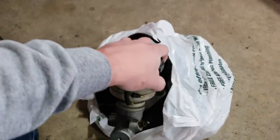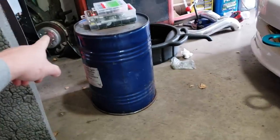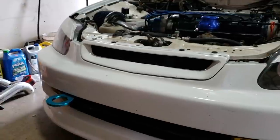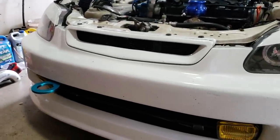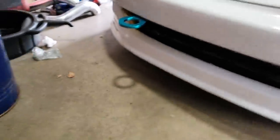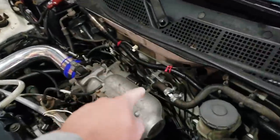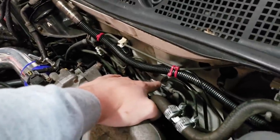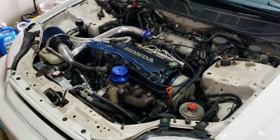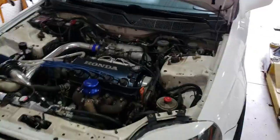But that's cool — that should give me a really nice brake pedal. I should also mention that I'm not using stock brakes. I'm doing Type R brakes in the front and EP3 brakes in the back — I'm going to do that Frankenstein brake setup again. So it'll be the same really nice braking power but with big disc brakes in the back too. I do need a proportioning valve. I have the 3040 one in here, the stock one. Technically you don't need one — a lot of people say you can run these with disc brakes in the back — but it's better just to get it. I'm going to try to get one within the next couple of days. Let's get to work.